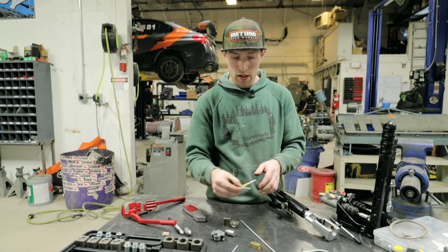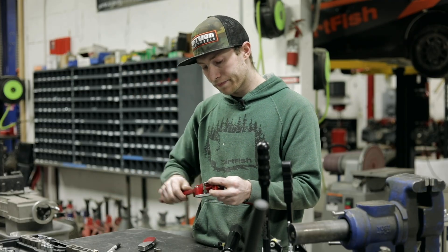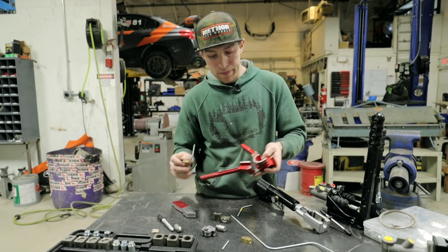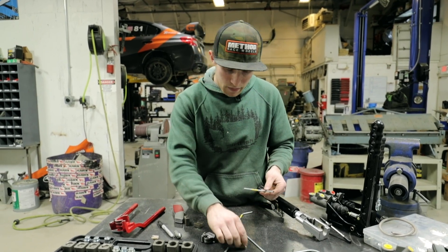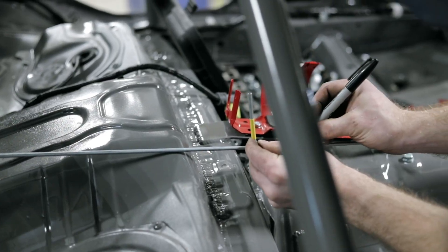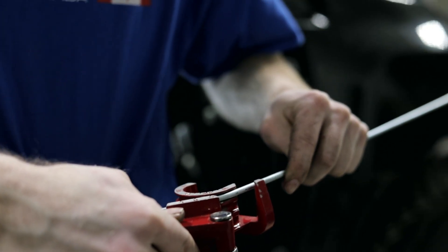I like to make these little dies right here — just a 45 and a 90-degree bend. The way I do this is I use my bender and make a 90-degree bend, then I mark right here with a Sharpie. I take these into the car when I'm building a brake line. Let's say I wanted this brake line to go around this T right here — I would put a Sharpie mark right there, line that Sharpie mark up with the edge of my bender, and make the bend.